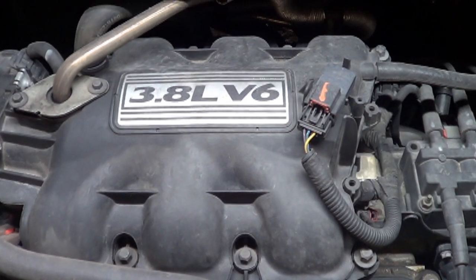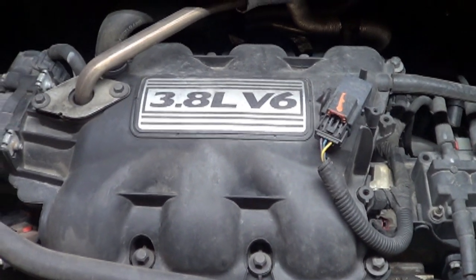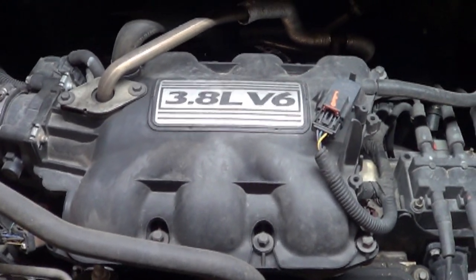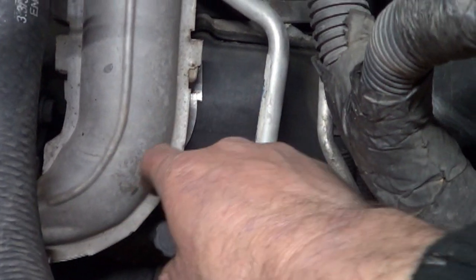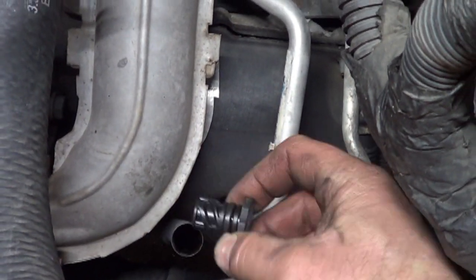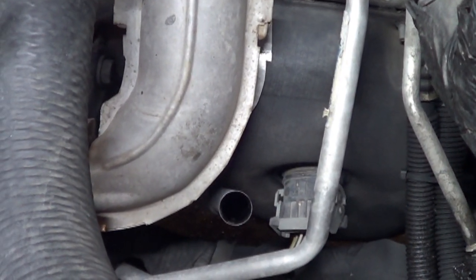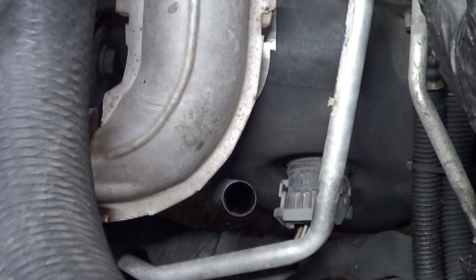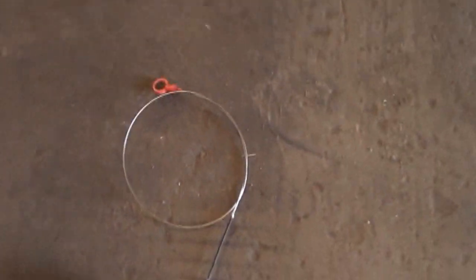Even as I drove this car into the shop, it was chugging and jerking as if the torque converter clutch was applied, so it's entirely possible the torque converter clutch is stuck on. On this vehicle there is no dipstick — there is a tube, and you need a special tool called a dipstick. It's part number 9336, basically just a dipstick to check the fluid with. Luckily I have one, coming from the transmission industry.